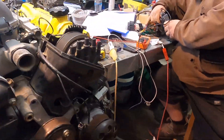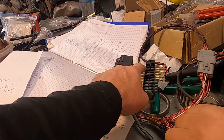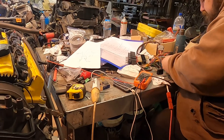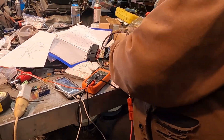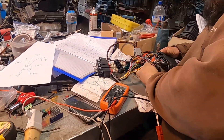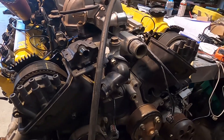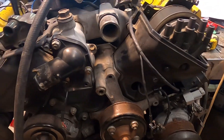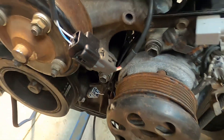It doesn't have oil pressure anyway so it doesn't really matter. Over here is the standard relay box — we have fan, fuel pump, ignition in, and starter motor starter input. We have a body plug and dash plug with oil pressures and oil temps, auxiliary outputs, and air conditioning input and output, tach — all the things Zach may want to wire up. Of course we have a water temperature sensor right there. If you want to run just an oil light it can be triggered off the ECU or come off that plug directly.